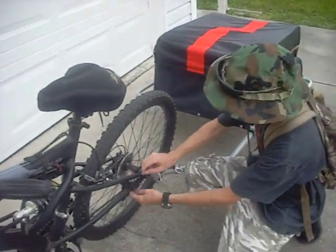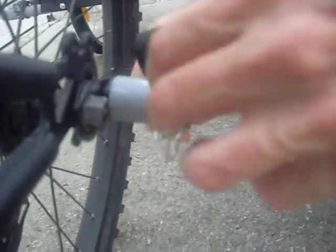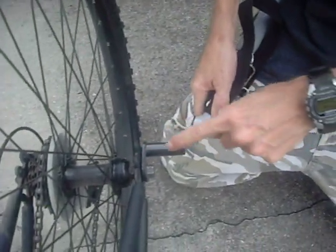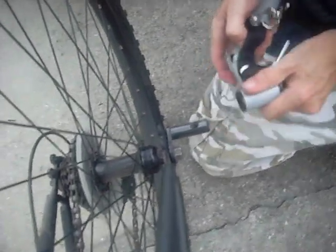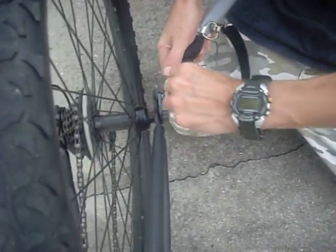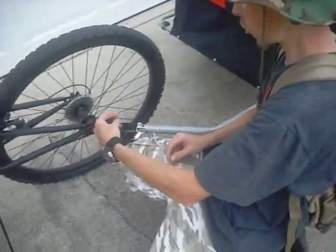This connecting arm is awesome. It has what they call a cotter pin thing, and it comes with this L-shaped bracket. You loosen up the screw for your back tire, put this little L-shaped bracket on, and it's got a spring-loaded arm that adjusts. You basically slip it on there, line up the hole, take your cotter pin, slip it in, make sure it latches, and don't forget to do your safety strap.